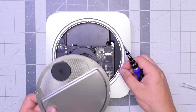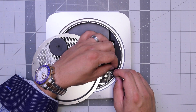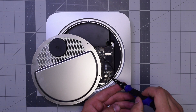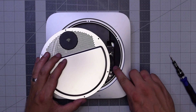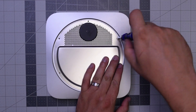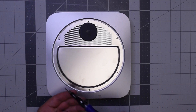Let's go ahead and reattach the WiFi antenna. Go ahead and align it with the WiFi and Bluetooth cord. Guide it in and make sure it pops in nice and firm into that socket. Just kind of twist it in and align that little retainer hole, because we're going to need to secure this last T6 screw right there. Then let's tuck that cable in a little bit. Align the WiFi antenna cover and let's secure the three wider longer post screws first — these are the TR6 screws with that little safety in the middle — and then the other three smaller TR6 screws.